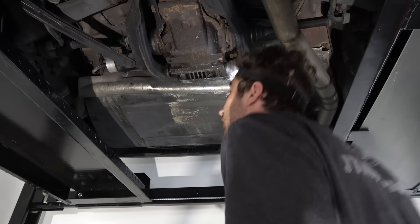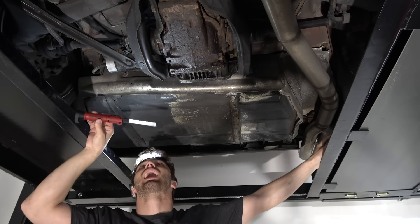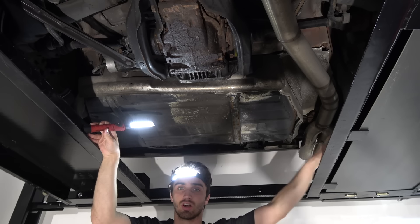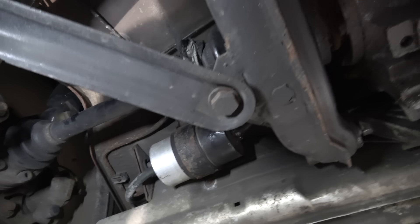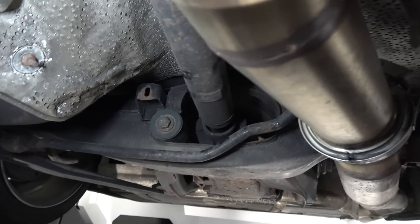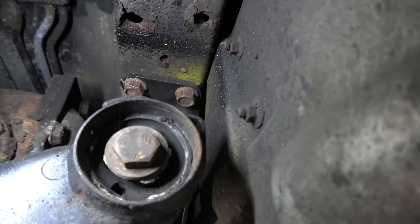Now the rear end of this car also kind of interests me because I beat the crap out of it. What you guys might not know is that I have had torn axle boots for six years since I first lowered this car into throwing stars. And I am still utilizing my torn axle boots. Stock 525 axles, stock 346 LSD medium case — and I have had, knock on wood, no diff issues, with a leaky diff. The cover's leaking here, so that needs to be resealed, but no axle issues, no broken axles, nothing.